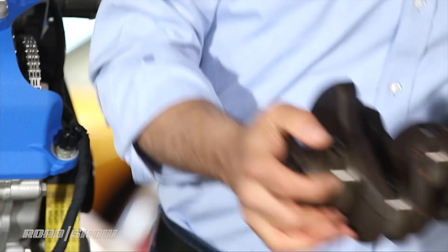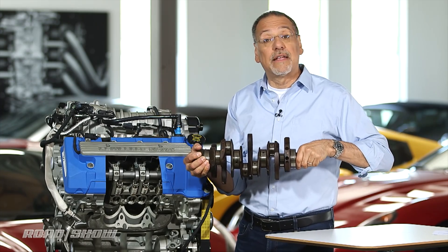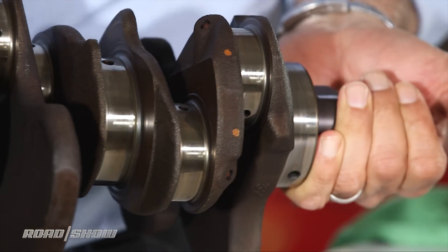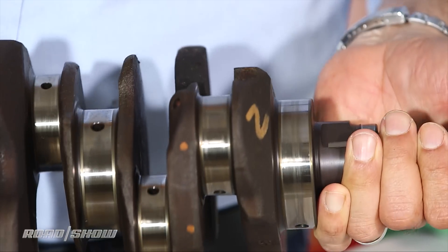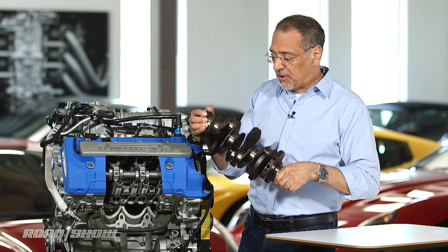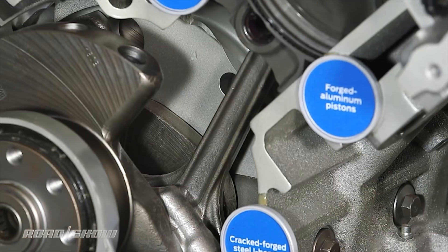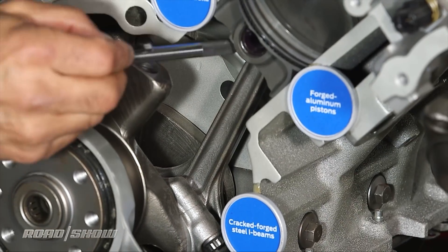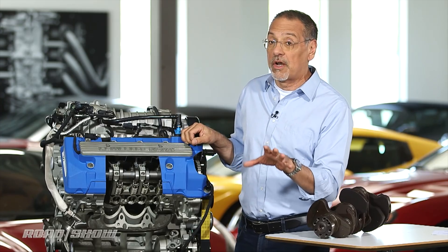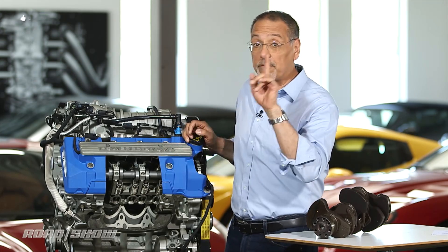The other part is this crankshaft. It lives down in the bowels of the engine, but all those shiny areas you see — those are called journals. They're essentially bearings, and you can see how polished they've become on this used crank. This is from breaking in a car: you get a very nice micro-mating between those journals and the bearings that go around them, which connect to your rods that attach to your pistons. If you allow that to happen gradually during break-in, your engine works better for longer.